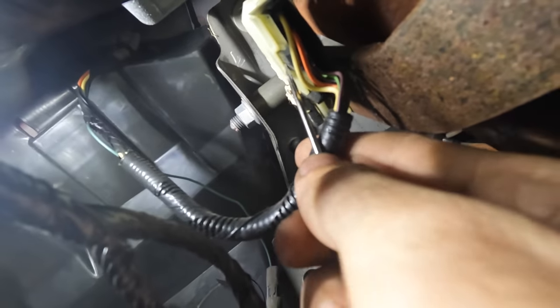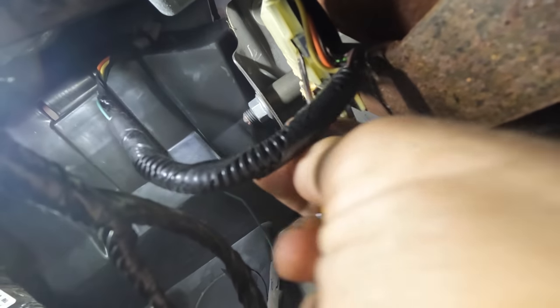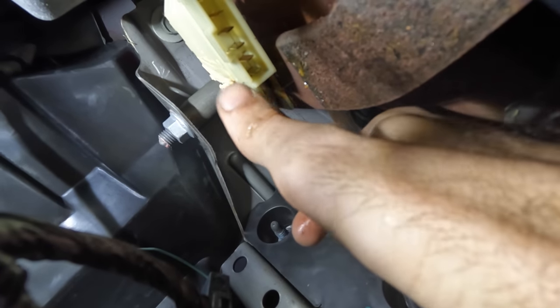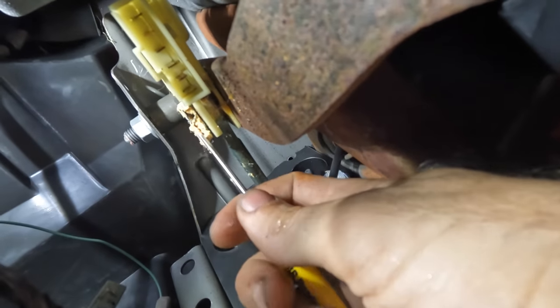One of the first things I'm going to do in here is get this brake pedal connector disconnected and pull this guy out. There we go - that's our wire for the brake pedal switch. And we're going to reach in. Someone's put lube on this, I can't see. There's a little clip right here that secures the switch and the brake pedal to the rod for the booster. So we're going to separate the pedal from the booster, and then we'll be able to reach up a little bit better and disconnect that shaft up there. I need a towel here, we're going to wipe off some of this grease - too much lubricant. Kind of like yesterday's driveshaft video - too much lube on the shaft.